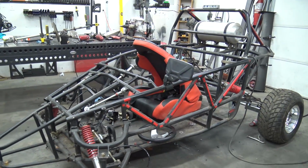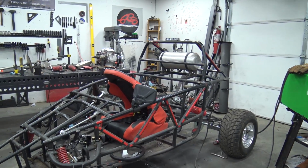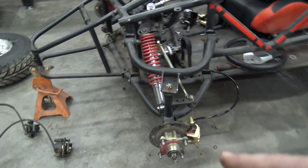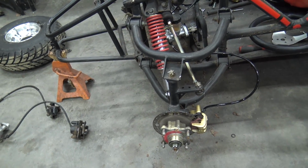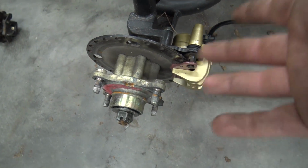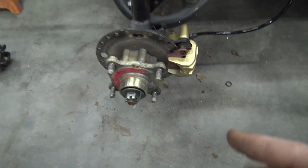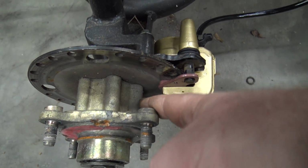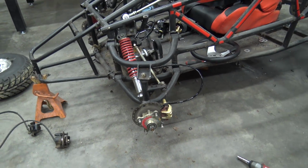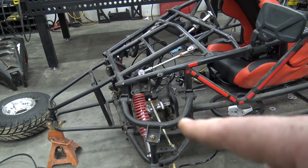And what we can do later in a month or so when we're going to add a big charging system to this engine that we're putting on here, we can basically pull these rotors off and use the smaller Go Power Sports rotors. Then we can cut the caliper mount off and shorten it, or just make a whole new one to sink that caliper in quite a bit, because normally the caliper almost touches the hub, it's so close. So I'm gonna get the front brakes deleted. I just gotta go buy some bolts that'll block off the holes in the master cylinder.